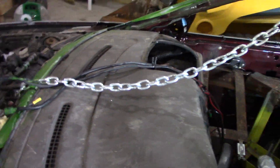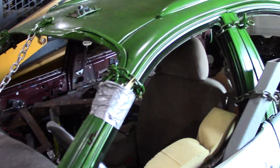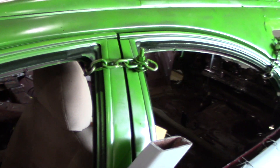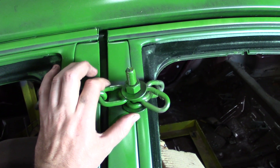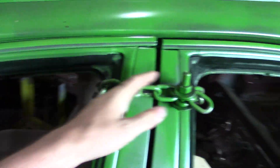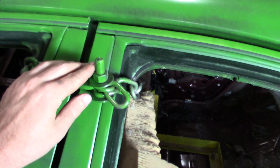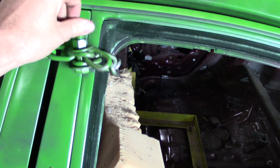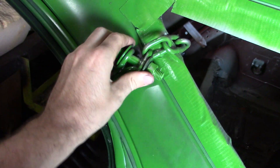It's a bit expensive upfront, but once you have the chain you'll never need to weld a bar in again — no electricity costs, no welding rods. You just bolt it in and you're good to go. The same logic applies to chain on the doors. You'll notice we have chain on all our pillars. Nine wire is really expensive compared to what it used to be, and you can easily go through an entire roll on one car. So I bought a bunch of short lengths — about a foot and a half to two feet long — and you just wrap them around the pillar and tighten the bolt with an impact gun.